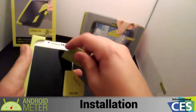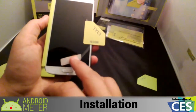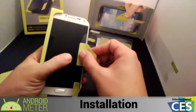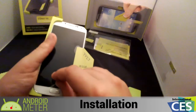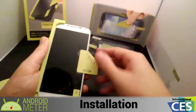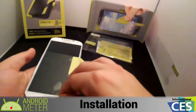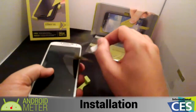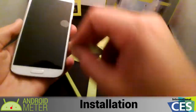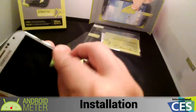I'm going to get this last one out — it's under the label so it's kind of hard to tell. Then you're going to pull by the two tab. One thing to note: you've got to make sure you don't peel off the screen protector. I have seen people do that, where they peel by the tab and end up picking up the screen at the same time, which can be a troublesome thing to avoid. What might be better is to take the device out of the alignment tool — we're not aligning anything anymore — and then you can get a better angle to remove the label. There we go — those two air bubbles are out.